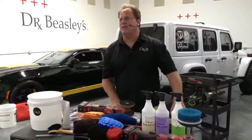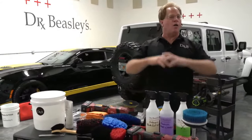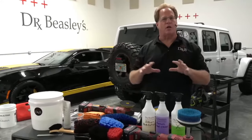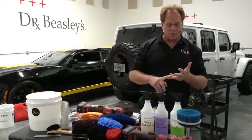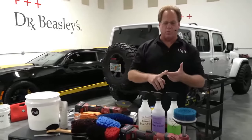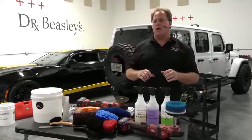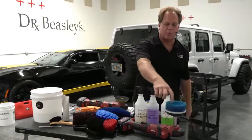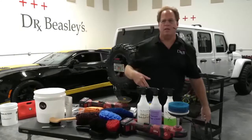Yeah, and one of the things we cover in our classes is called extreme prep wash. It's where we do all the things you can do to get a car clean before you bring it into the shop to start doing all the paint correction work. And that includes topical glass polishing, wet wash engine detailing, machine scrubbing tires, cleaning the wheels, chemical decontamination, mechanical decontamination, cleaning the jams, machine scrubbing any cladding, so any plastic cladding. I also show machine scrubbing that instead of, the human hand is just so limited. And then, of course, washing the car.